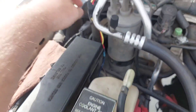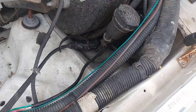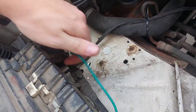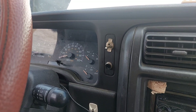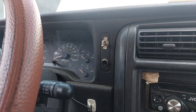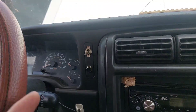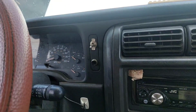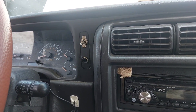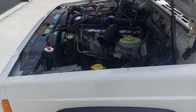Here's my whole wiring situation: this wire goes to the time delay relay, this one goes to the switch in the dash, and I got them both fused right here. The dash wires I stuck through the rubber grommet under the master cylinder. From the relay I just spliced into the stock fan wire — you only need to do one splice, which is nice. This retains all stock functionality, so when you turn on the AC or the engine gets too hot the fan will still automatically come on. You can also manually toggle the override at any point — in traffic, on trails — and it runs the fan for two minutes.